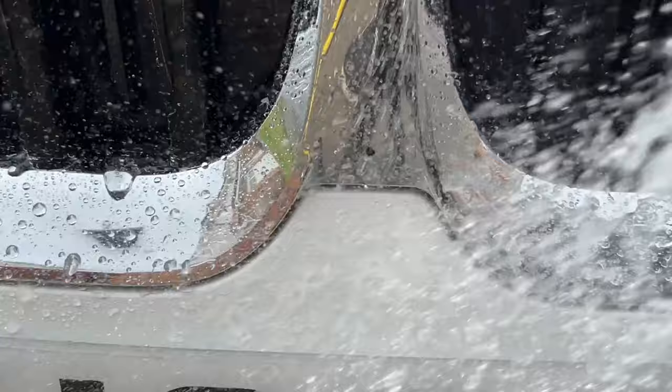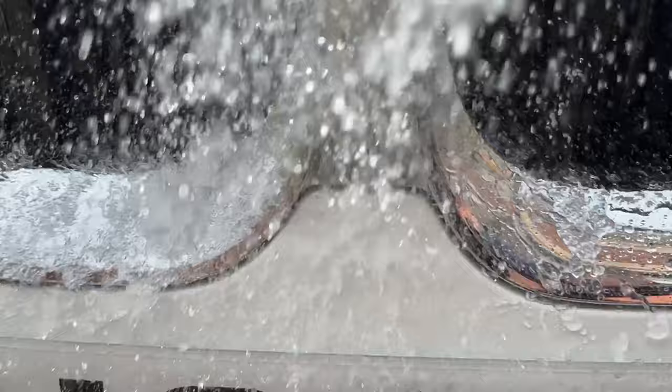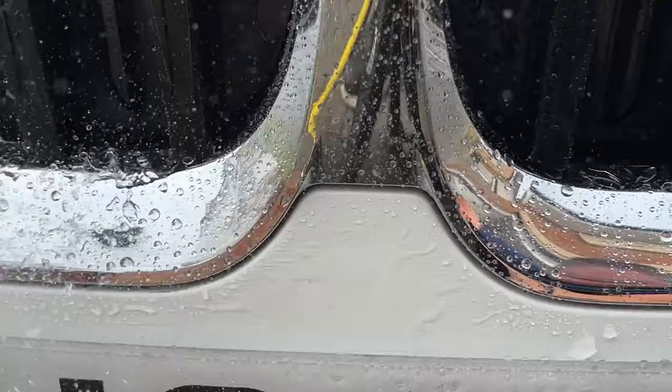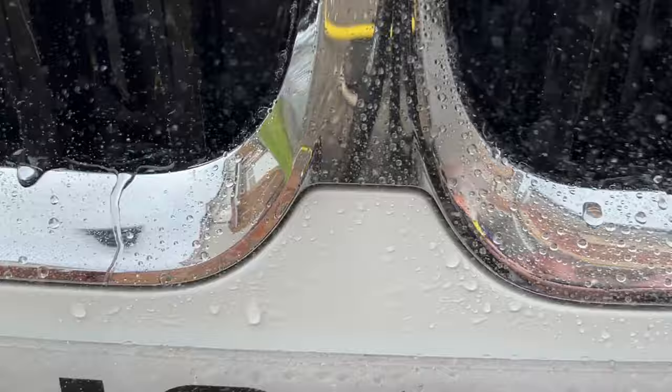There wasn't a great deal of cleaning to be done there, but it was more to see if it would remove the hydrophobic properties of the wax. I still think Zero Decon Shampoo isn't the most suitable product for bug removal — not at this dilution anyway on a waxed car — as it definitely has had an effect on the area it was sprayed on. Maybe less of a complete wipe-out than before, but it certainly has had an effect, as I'll try to demonstrate in this before-and-after.